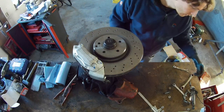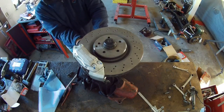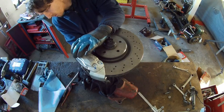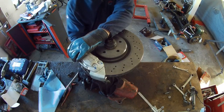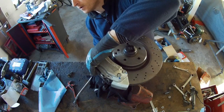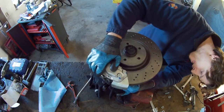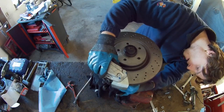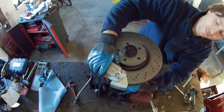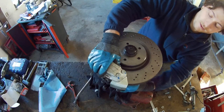So here we got these bolts. This is an M12 bolt. It needs to be tightened to 122.6 newton meters. Yes, 122.6. I'm not going to do that now. Put them on torque, because it needs to be dismantled to put on a car, otherwise too heavy, but I'm going to show you how it looks.